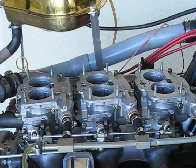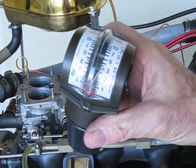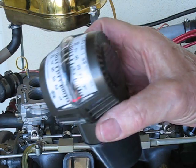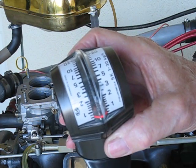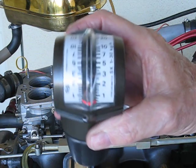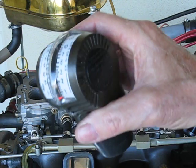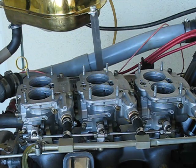I'm going to show the balance of the air flow on the six barrels of the carburetor, and I'm going to use an STE type SK flow meter, synchro meter. The scale is calibrated in kilograms per hour of air flow from one to thirty. I'm going to idle the engine at about a thousand RPM, plus or minus, for the test.